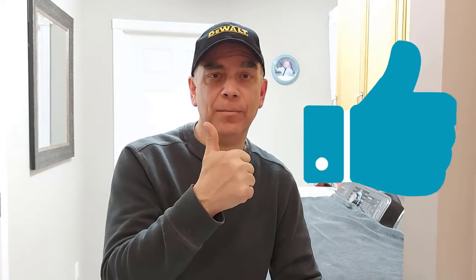Well, that's another job behind us. I hope this dryer vent duct cleaning helps you out. Remember, you don't want this to clog up and cause a fire. It will also cause your dryer to work harder, wear it out quicker, and your clothes won't dry — it's just a waste of time. So just get the lint cleaned out. Always clean your lint catcher, pull it out and clean below the lint catcher, and clean the duct that goes towards outside. Don't forget to check out those products for helping you clean your duct — they'll be down in the description. If this video helped you, give us a thumbs up, hit that subscribe button, and we'll see you on the next video.